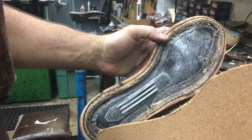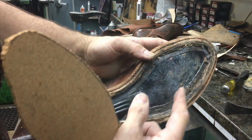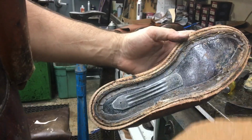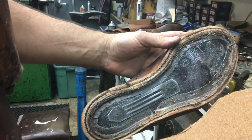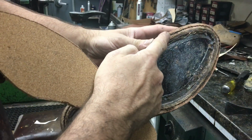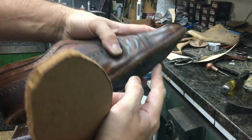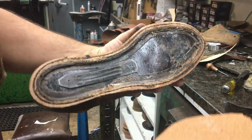Anyway, here's the cork that we're going to put in here. Most of the manufacturers will use hot cork. It's basically hot, and then they spread it throughout the whole cavity of the bottom there. The idea is that it's cork either way, whether liquid cork or cork from a sheet. The idea is to fill from this point to this point to level the surface, so when you're stepping down there are no spots where you feel that indentation. Alright, let's continue.